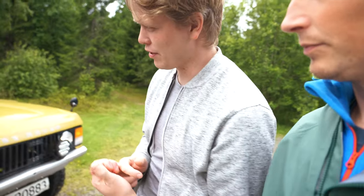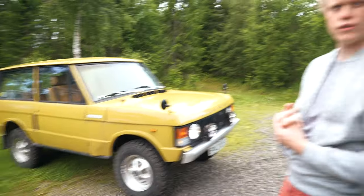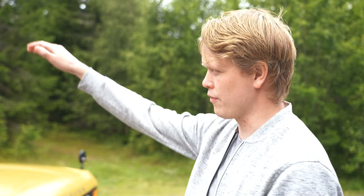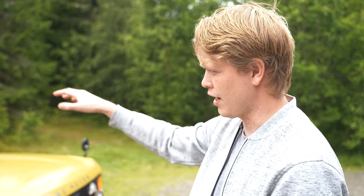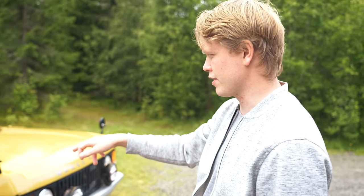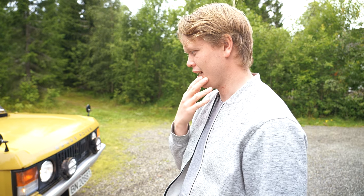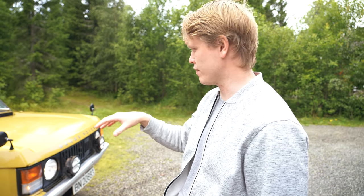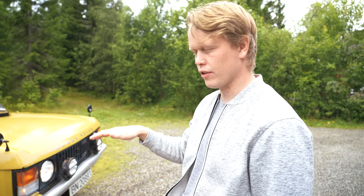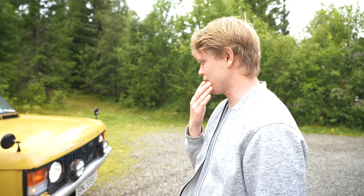I got new springs in May. So it's a bit taller. But that was mostly to conquer the, when I have the roof rack on and the winch, and loader in the back, it's not even anymore. I think it was 5 centimeters lower on the right side than on the driver's side. So the suspension didn't handle it anymore. So with these springs, it should be hopefully close to standard when it's loaded. Now it's empty, so it's a bit taller.